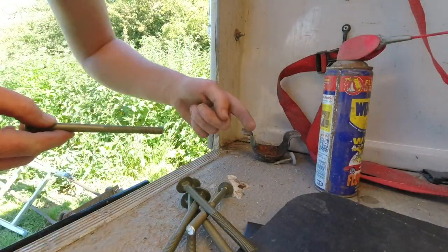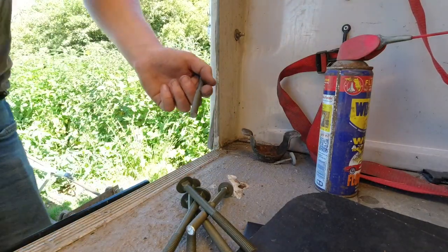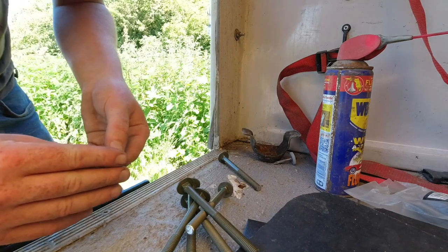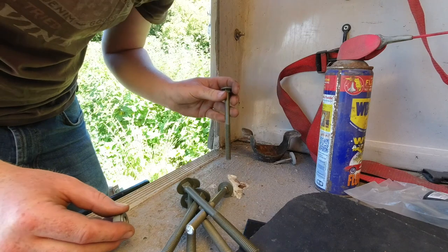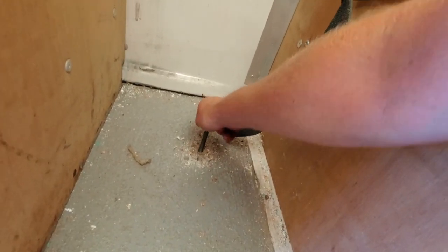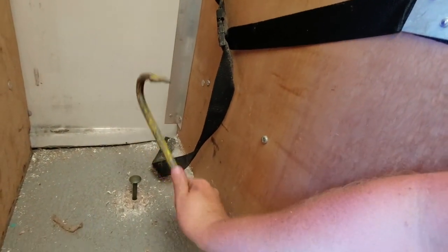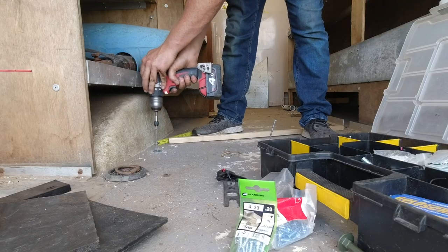Bought these, which were double the length because when I had the frame, so now I just have to go ahead and knock all them down to half the length, and then I wanted to use some nylocks, but obviously being coach bolt heads, that ain't gonna work, so I can use these but then double them up and thread lock them. I went around the box drilling holes through the floor and directly into the chassis, sinking the coach bolts through and bolting the whole thing together. In total it had 4 mounts either side, but I also added some screws through the floor into the remaining cross sections just for good measure.